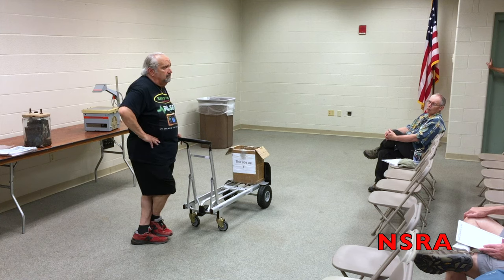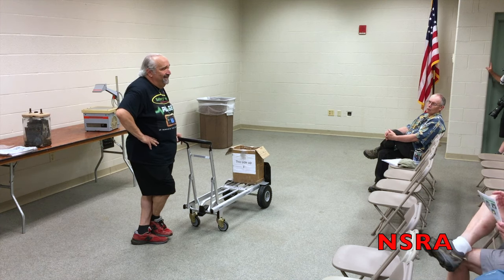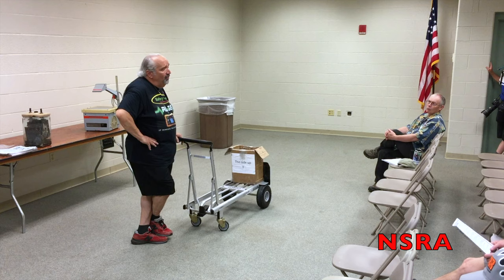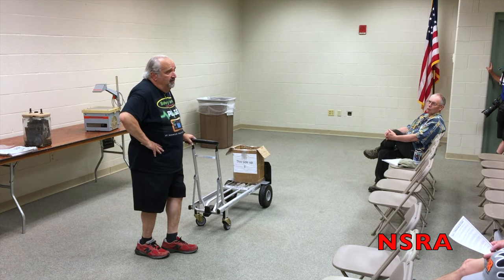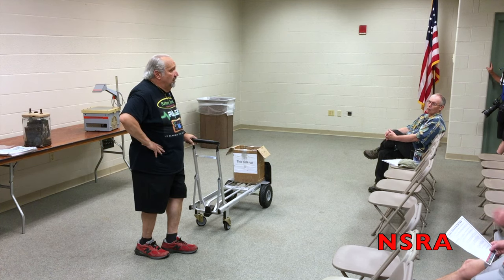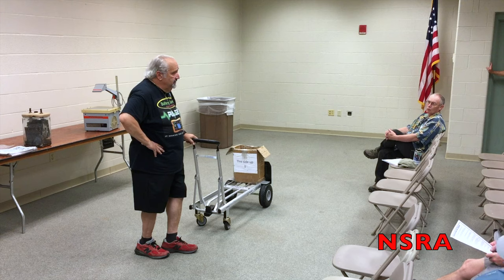We always stick them in a stainless steel box or a plastic box or something. Right. Well, vents are the most important thing to old-fashioned batteries. If you're going to go with non-vented boxes, you're better off with an AGM battery, because it has less venting than a maintenance-free or a maintenance battery. But venting is definitely important, and temperature. I mean, they are just really important things.